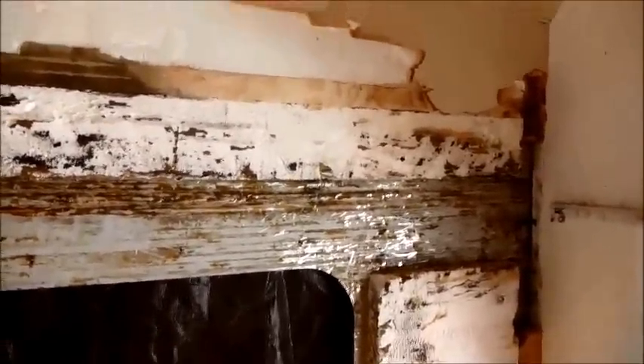I've got a new piece to go in there, then we'll bond that. I've got some aluminium filler. I took the ladder off because it was also leaking through there. Multiple holes — someone hasn't put the window on properly, and this is from new — virtually 5,000 miles on this vehicle. Everywhere else is okay. Hopefully my bonding and window seal are coming tomorrow. I'm not going to put that on yet. Then we've got another piece of wood to be planed for the whole length, and then I'll show you how I get on putting it back together.